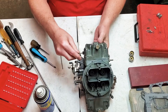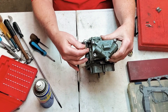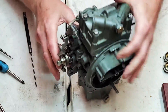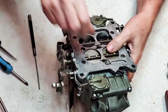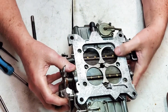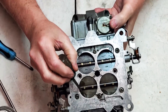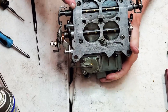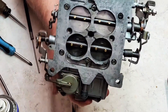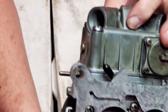There's a front and back - look at that plate we got in that accelerator pump. We don't want that, so we're going to have to take it out. First, I'm going to check how much of our transfer slots right here are actually open - that's just about perfect right there. Let me see if they can get a shot of those transfer slots.